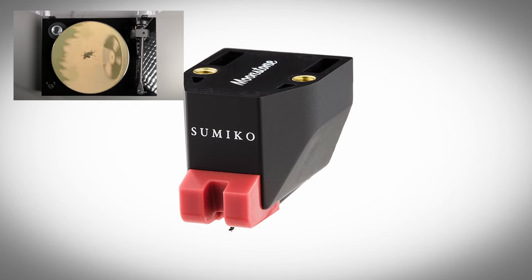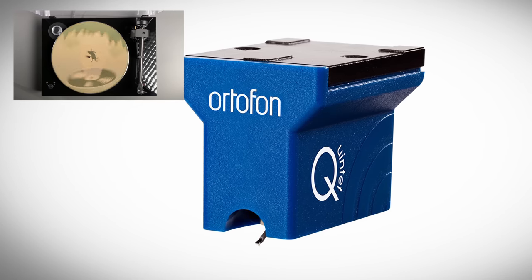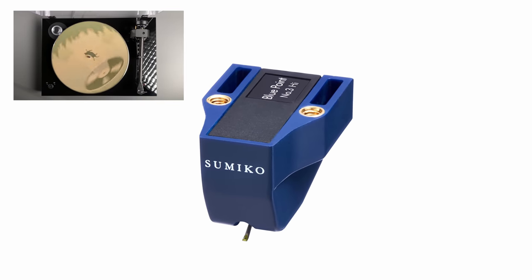Here in America, and Latin America, you'll find the Sumiko Moonstone cartridge standard with the X8, and in Europe you'll find the Ortofon Quintet Blue. Unfortunately, I'm not sure what they're getting in Canada. My review sample came equipped with the Sumiko Blue Point No. 3, which would be an additional cost, and I would dare say that this is the bare minimum you would want to have when picking up a turntable such as this. I would actually suggest buying the table without a cartridge at all, which would then retail for about $2,000, and simply adding whatever you think best.